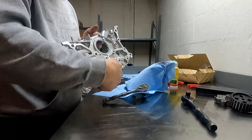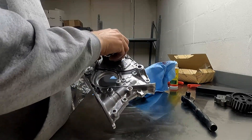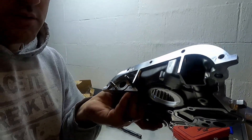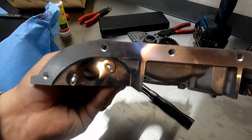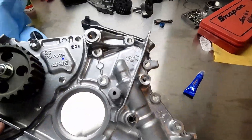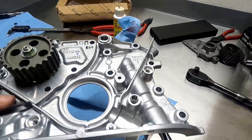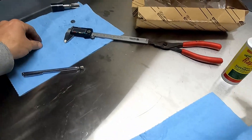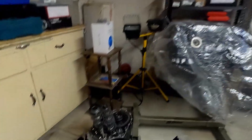That is a shimmed and safe-as-can-be second-gen style oil pump — 5S second-gen style. There it is with the plug. I just have to put the seal in, change the gear, and put it on the engine. I just wanted to show you guys what I do — that's my little mod, but it works and I think it's a lot safer than the washer method. I should be getting that gear soon so I'll go back to the trans, get that buttoned up, and keep going on the engine. See you soon.